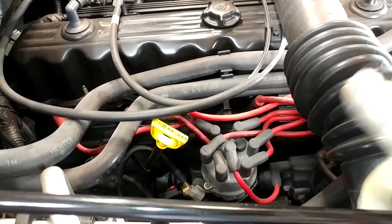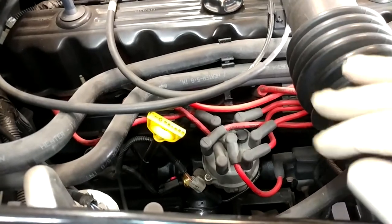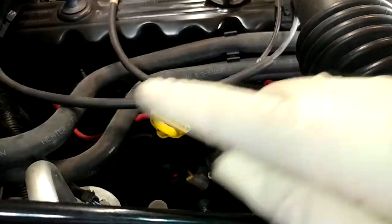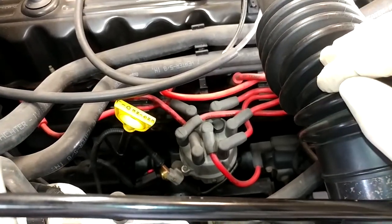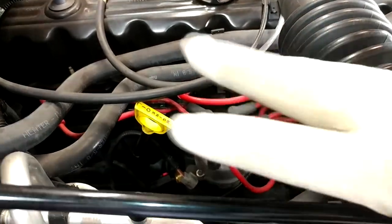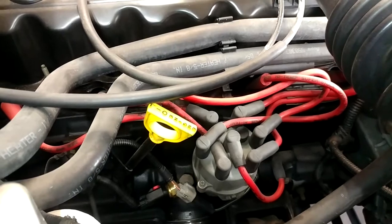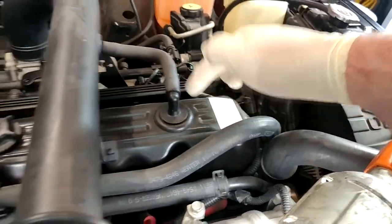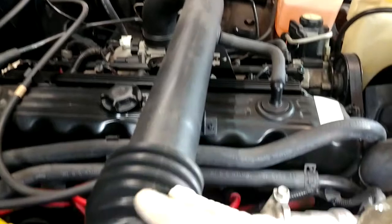Now we're ready to actually start taking parts off the Jeep. Normally when I do stuff like this I follow my dad's first rule of changing spark plug wires — if you don't know what you're doing, just do them one at a time, then you can't screw up your firing order. Since after many decades I still don't know what I'm doing, that is typically how I still prefer to do things. With a distributor though it's a little hard to do them one at a time when we're also replacing the cap and rotor. So there's a cheat code for this — we identify our number one spark plug, which on this inline six is just one through six.